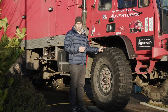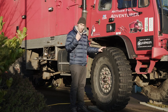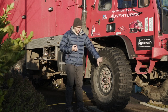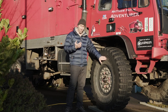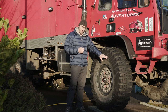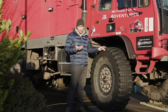Last week I talked about doing a daily inspection of your vehicle before you drive it — have a walk around, and in particular check for worn wheel nuts. It's also good practice to have a good look at your tires. Visually inspect them and look for any cuts or slits, especially if you've been off-roading and could have damaged the sidewall. A cut in your sidewall poses a threat to rapid deflation.